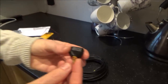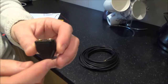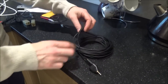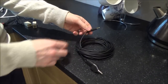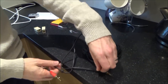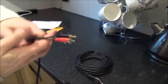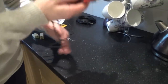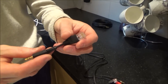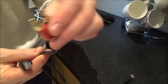If you want to connect it in two places, you could get a little headphone splitter — you can even get ones with five outlets, one male to five female. Just plug this into your Amazon Dot, then put one cable as aux in to your hi-fi and another cable with a 3.5mm to twin phono or RCA adapter into your TV's input. That's the straightforward way. What I've done is wire it into my network cabling, which meant I had to make custom cables — butchering 3.5mm leads to put my own RJ45 plugs on the ends.